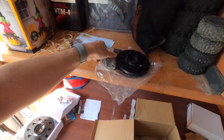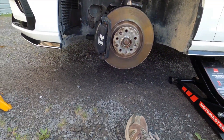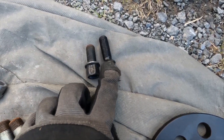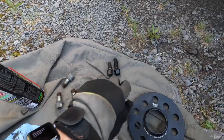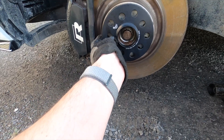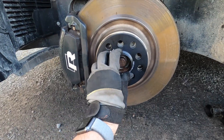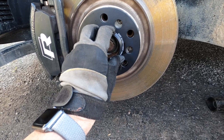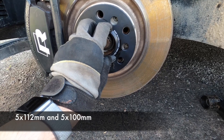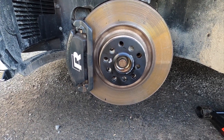That's all we're doing — putting wheels on, but with hub-centric spacers. Ready to put the fronts on. Here's the 10 mil next to the stock. We're going to put this on. There is an orientation for the bolt pattern — you can see it's made for two different bolt patterns, so just rotate it until your bolts line up. And that's all there is to it.